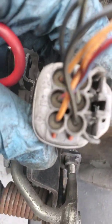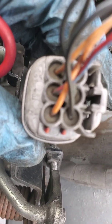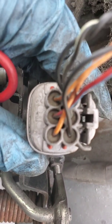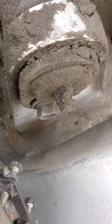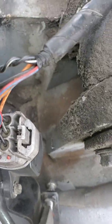this potentiometer has two potentiometers. So it has two 5-volt references, two grounds, and two signal wires. So there's an orange with blue and a solid orange. Those are your 5-volt power feeds. The black wires on the end, let me just get that stable.